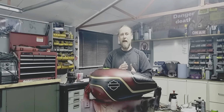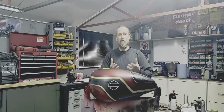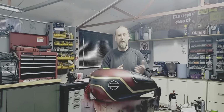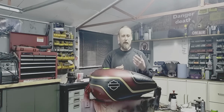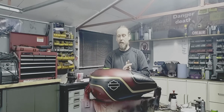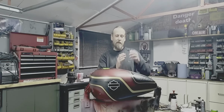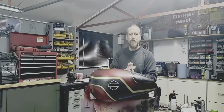the clear coat lies. When you're painting at home in the garage, always either damp the floor or blow it out, just to stop any dust that's above the roof or anything else just coming down on you. So I'm going to get this garage up to 70 degrees, put the extractor fan on, and then shoot the clear on.